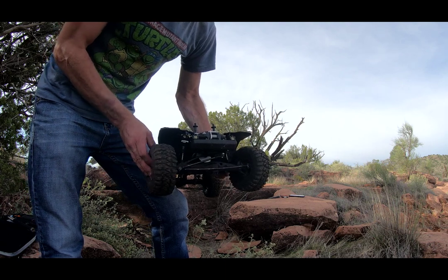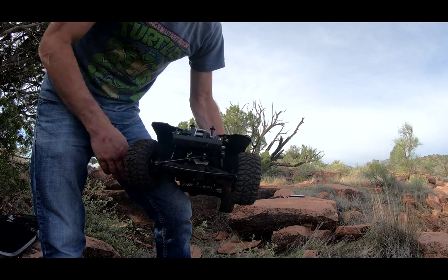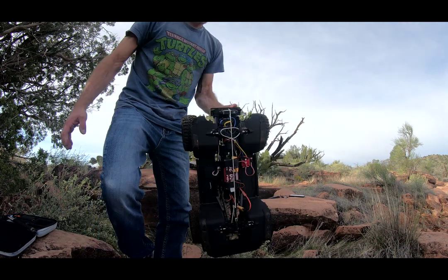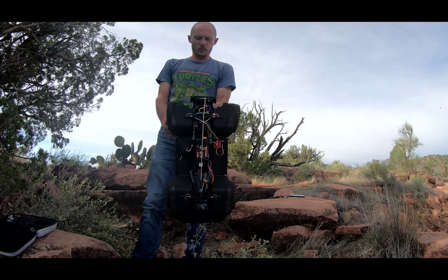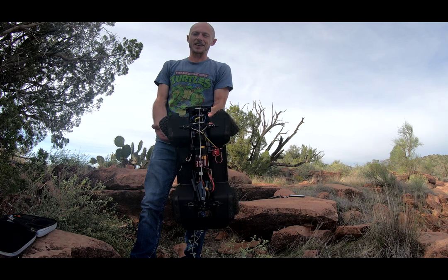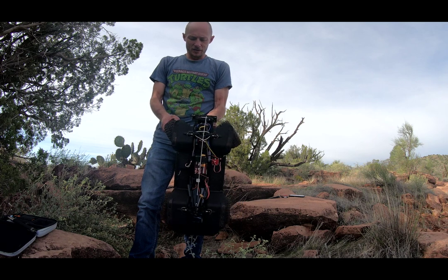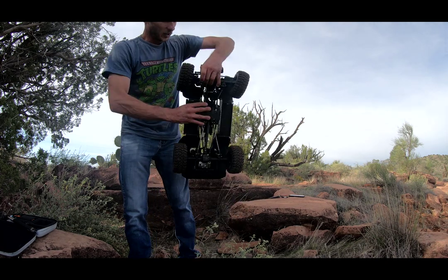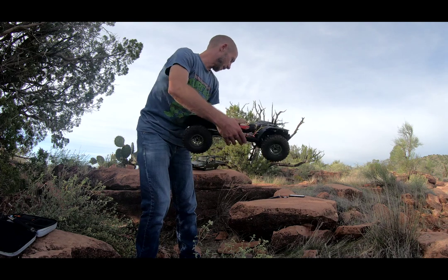Something I did was add a little spacer to the front steering bar to kind of pitch the wheels outwards. I really hope you can see, but they're toed out. And it's intentional, because when I'm turned all the way over, both tires are as close to 45. The inside tire turns more. A step closer to proper Ackermann, but we're going to have to go through and move the mount point on the knuckles if we really want to dive in and make it all perfect.